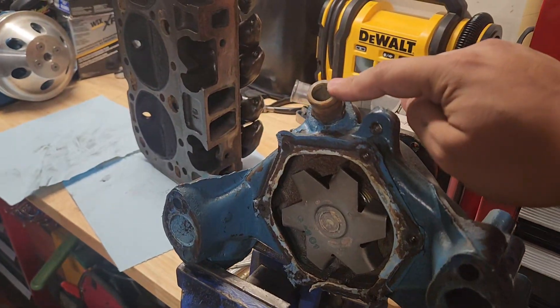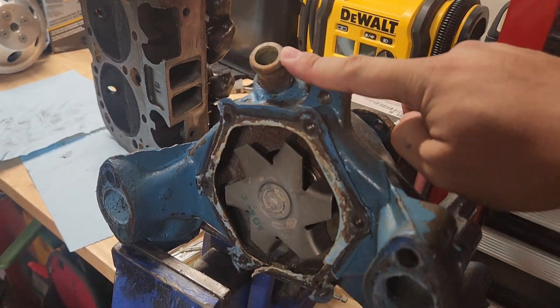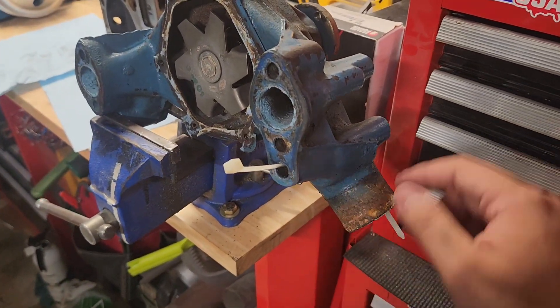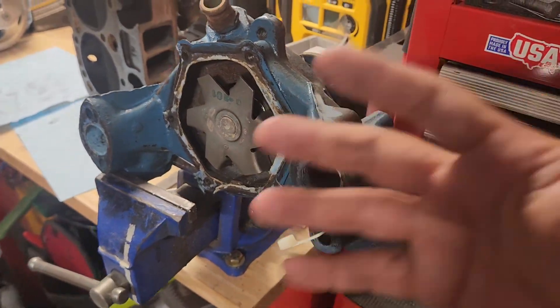This port here is for the heater core — it's not the bypass like you would think on a Vortec-style pump. So that's one thing I wanted to cover: the bypass has a dedicated feed from the radiator, the rotation of the cooling fan sort of favors the driver's side head, and that is another reason this bypass really is needed.